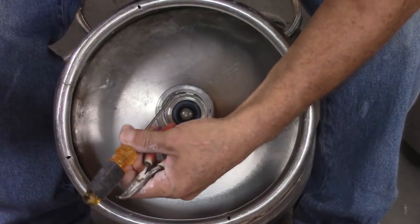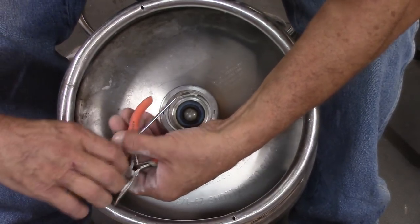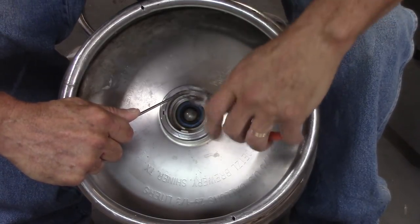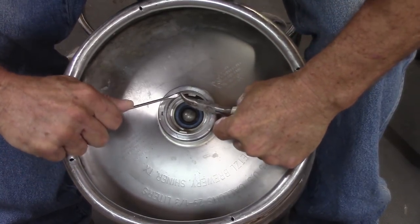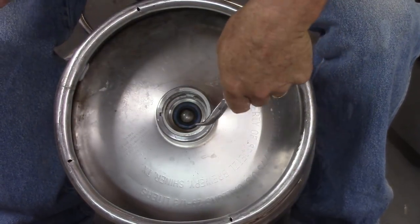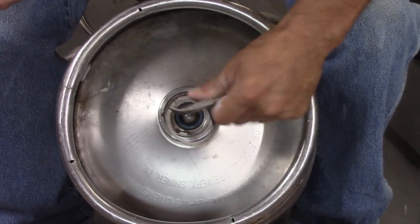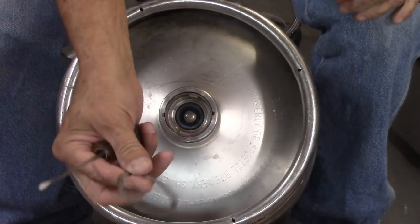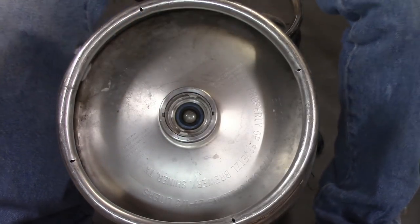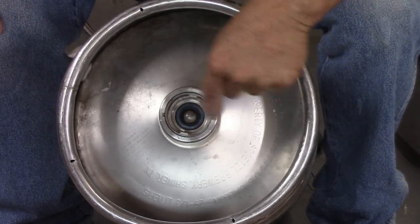These can be tricky, so I'm going to knock a little flat-tip screwdriver up underneath it — and there you go, I got it popped out. I'll grab it with needle nose pliers and you'll see that ring just comes out almost all by itself. There's your ring — that's the retainer. Now the next part is we're going to use a slightly larger screwdriver and beat this around until we line those lugs up.